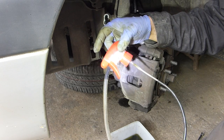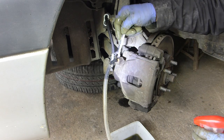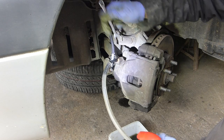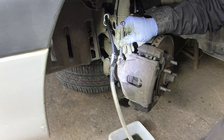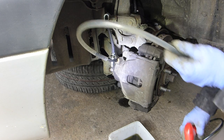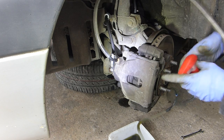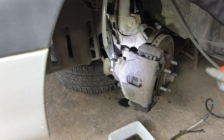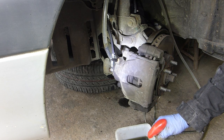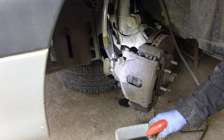This was a furniture polish pump or squirt thing — anyway, this is how we do it. I'm just going to crack the bleed nipple while it's already open. It will suck in some air through the thread here — that's normal and you will see some bubbles. So if you hold this up like that and we start squirting — I have a little tray on the ground here. As I pump air from the tube, it has to pull in the brake fluid.